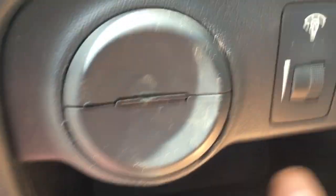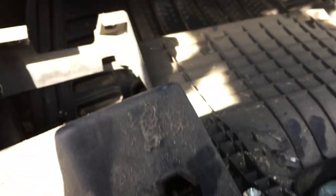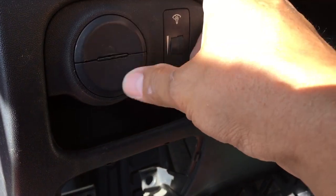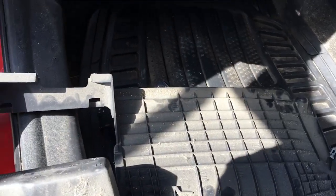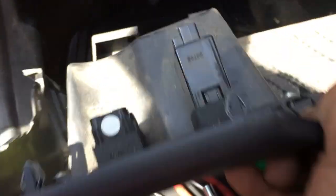After that, the only thing you have to do is pry it gently so that you don't break these little locks right here. There's one lock where the fog light or the cover will be, so it starts there — one, two, three — and there are two more on this side. Don't just pry it open; put a soft plastic tool so that the pressure comes off gently.